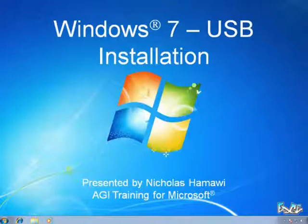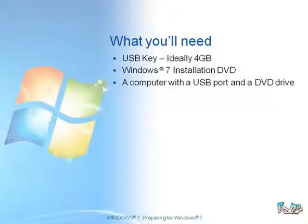It's also useful if your computer doesn't have a DVD drive, like my own notebook computer. I decided that it was more important to have a second hard drive rather than a DVD drive, so creating a Windows 7 USB key was just what I needed. As a prerequisite, you'll need to configure your system's BIOS settings to ensure that your USB drive is selected as the primary boot device.